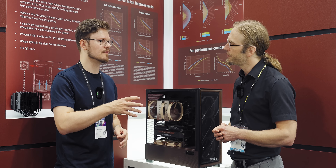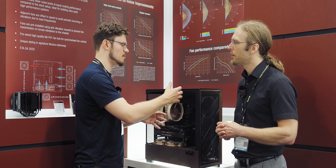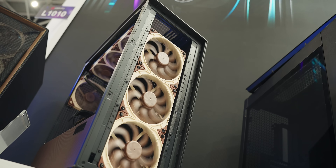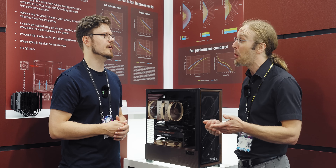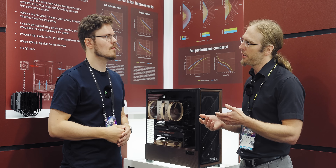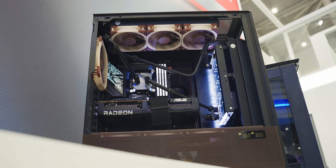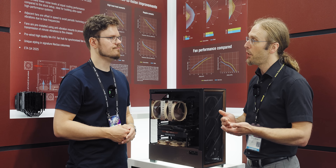Would that information about extra turbulence from increased airflow lead into better case design or better fan design specifically targeted for cases? Reducing turbulence and flow impedance in case design is always a good thing — though it's unavoidable to a certain degree unless you're running a completely open bench table. For the end user, the key takeaway is that more is not always better. Really experiment to find the sweet spot for your system rather than just running fans at full blast, because you may actually be able to drop RPM levels quite significantly without any thermal disadvantage.